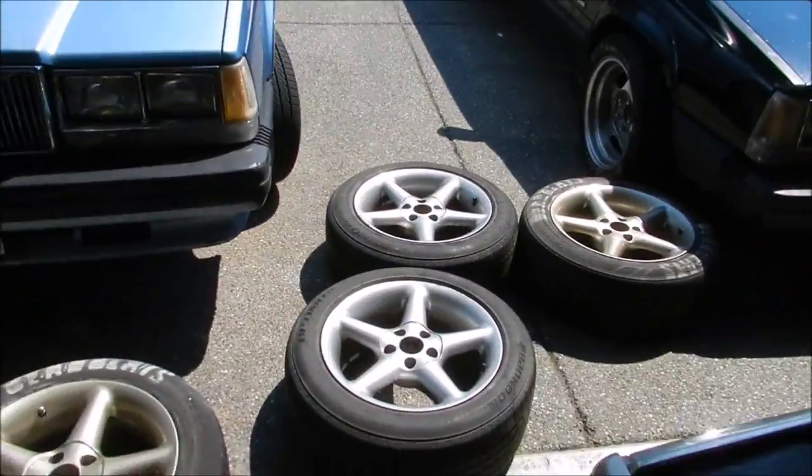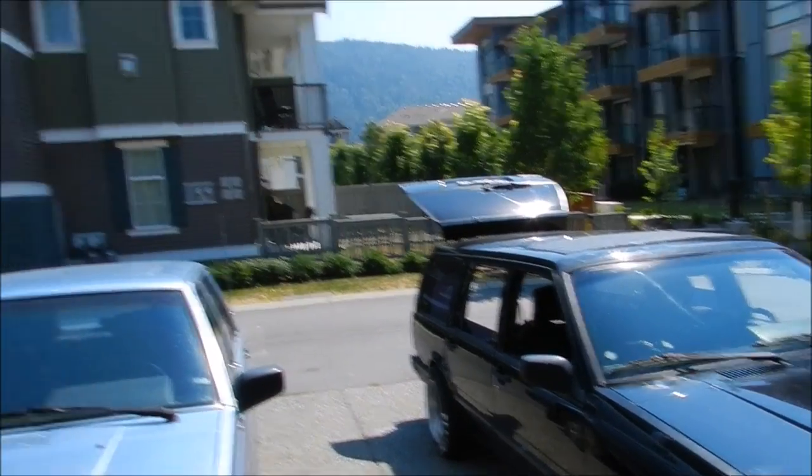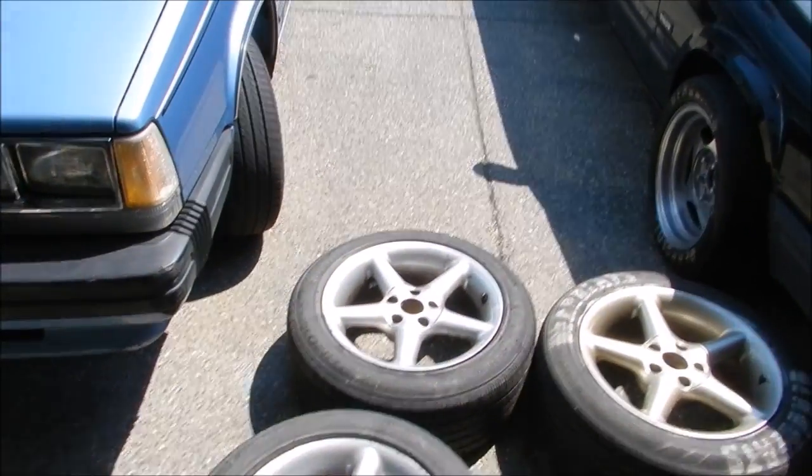So now onto the video. I'm going to swap these wheels on Sid's car, she's going to go to work, and then I'm going to go over to Scott's with the different tranny mount. Also, while we're at it, me and Scott are both going to do the camber mod. After that, if we've got time, we're probably going to go for a rip in Scott's car. I'm not going to drift the wagon today because it still has an open differential. I tried to drift it last night and the momentum doesn't carry — one tire just starts spinning. It might be a G80 locker, but past 40 km/h the G80 opens up completely. Me and Aaron are going to do the locker mod this weekend, or weld the diff if it's open.